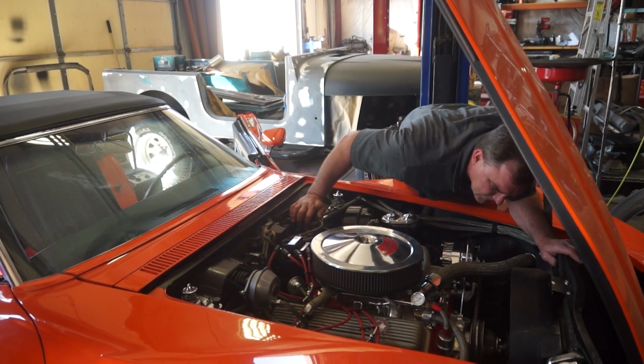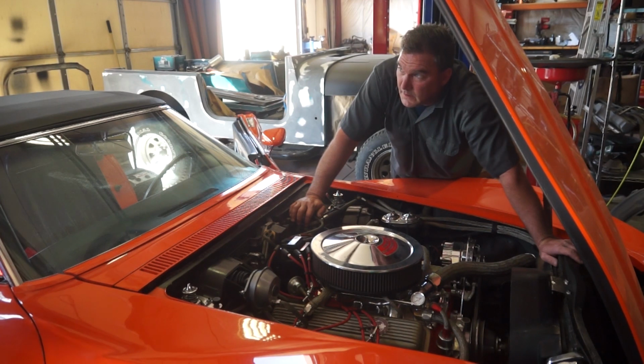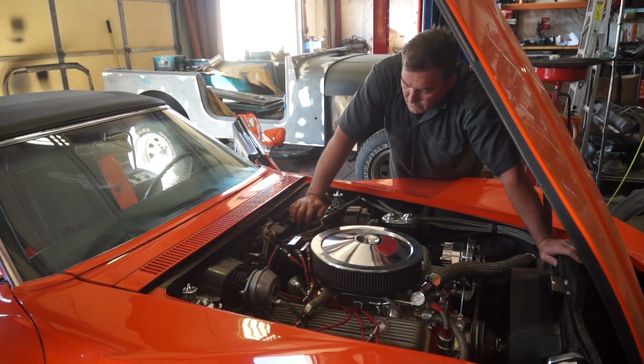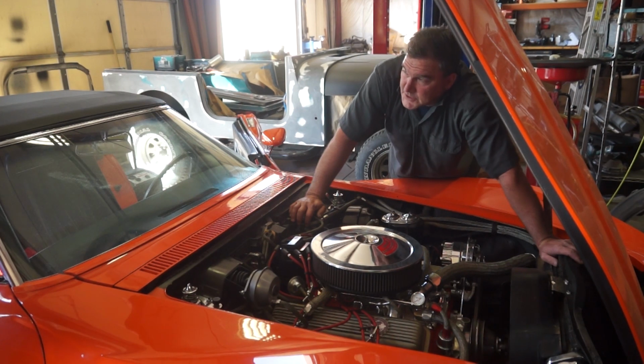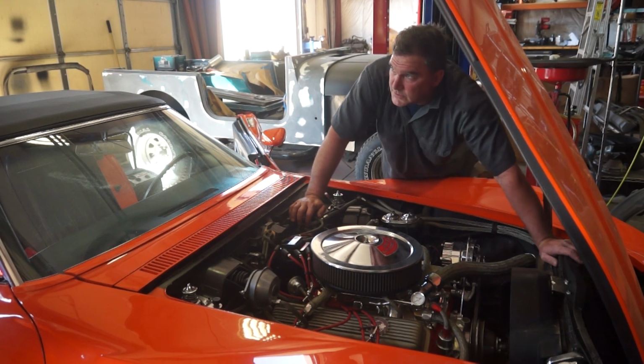I was watching a couple of those guys that used to work with Richard. But you normally hear that sound of roller cams. Well, retrofit roller cams make a hell of a racket, which is why I hate them. That's why I'd rather build a one-piece rear main that has provisions for the factory rollers.